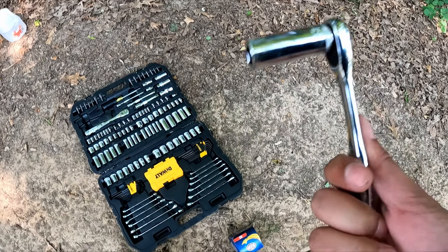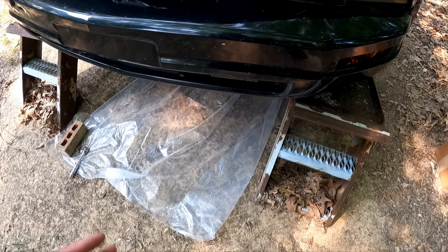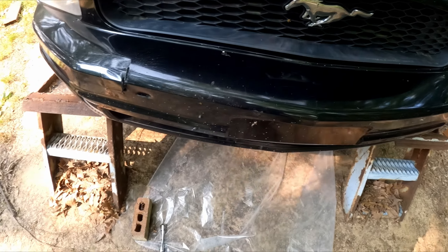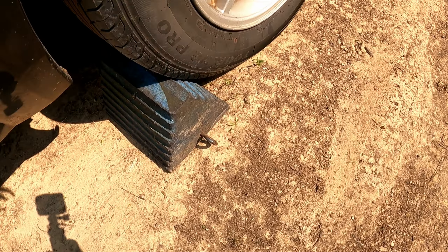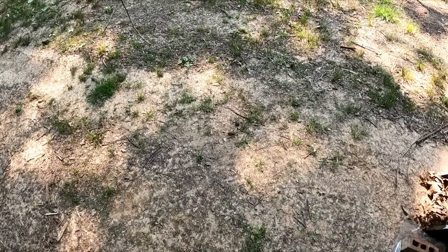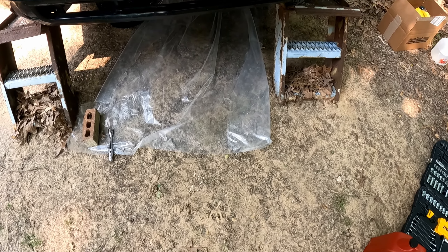You can use a regular socket. I personally prefer car ramps over car jacks when I'm going to be under the car doing work for any period of time. I'm on dirt so I put down plastic to keep it clean. You're going to need an oil pan to catch the oil, and you also need to chock the wheel so it doesn't roll back. Always remove the key from the ignition — that way nobody can crank the car with no oil in the engine.